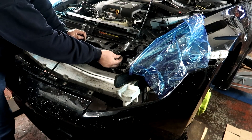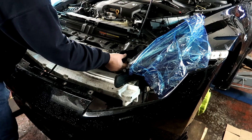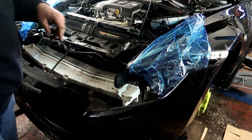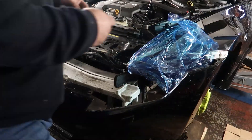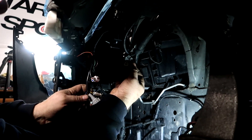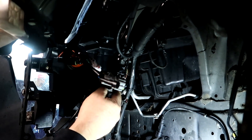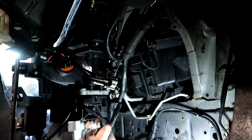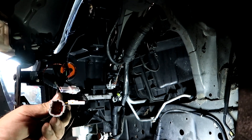Here's my link wire running across from the other side — I've just tucked it down by the side of the headlight. Now we're going to go into the back, bolt this back in, and I'll show you how to connect all the wiring. There's your little plug from the main harness — plug it in there, snap it into place. This main one goes to the actual harness on here.